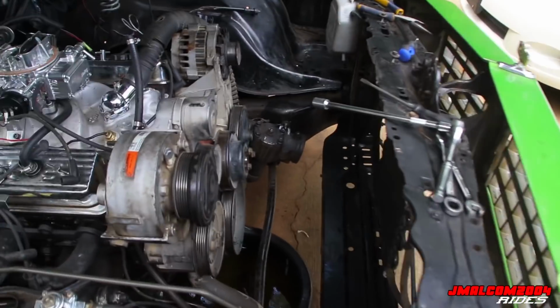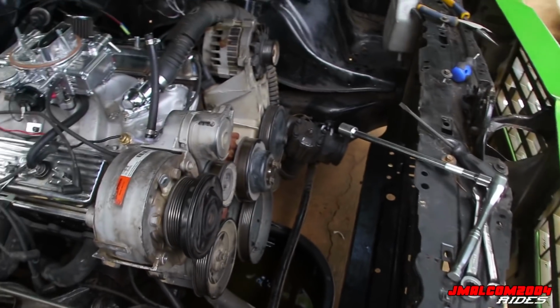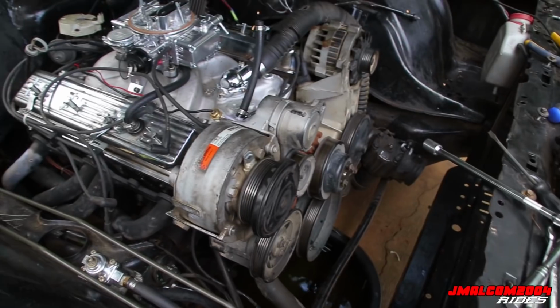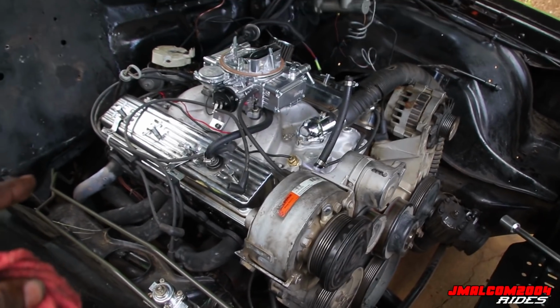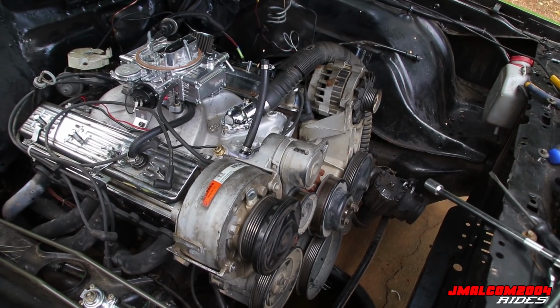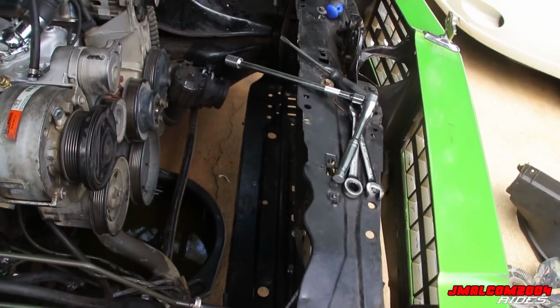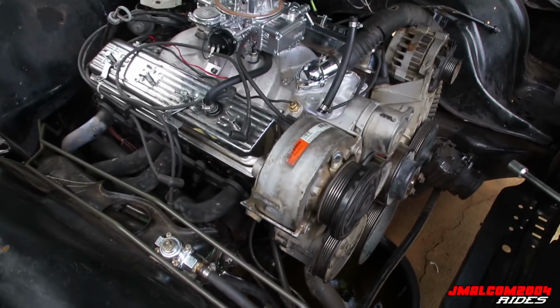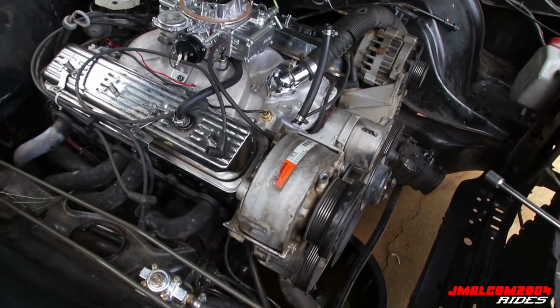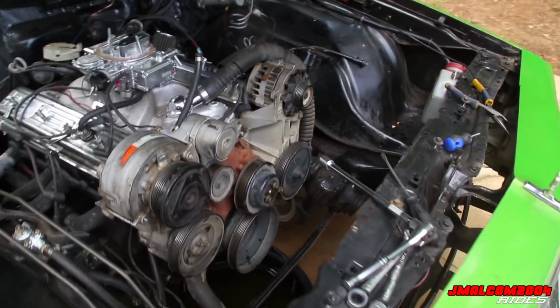That ain't nothing. So what I'm about to do is take the water pump off, because we're gonna have to take it off anyway to go on the new engine. Motor mount bolts, which I actually can hit like the car sits. I mean, I can slide on the hill without jacking it up. I fit. So I'm gonna go up on there and hit those, take the motor mount bolts loose, and then I'm probably gonna wrap up.